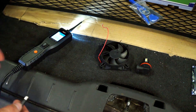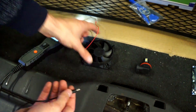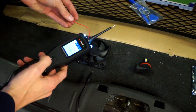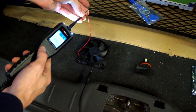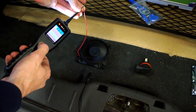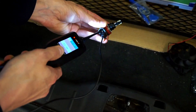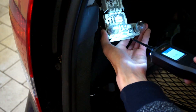Checking voltages and fuses is fairly easy, so let's try using the ground lead to activate some components. I have a 12-volt fan and I'm going to connect one of the wires to the ground lead and use the probe to connect to the plus side. As you can see, nothing happens because I didn't activate the voltage — and now I can see that the fan works. The same goes with LEDs, and we can also check components installed in the car, like those lights over here.